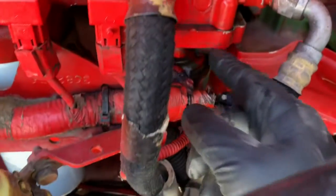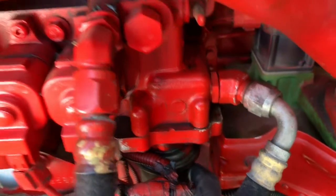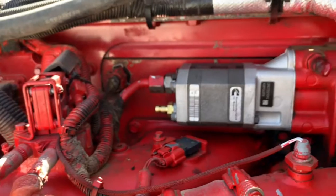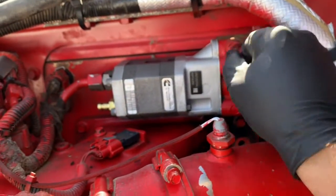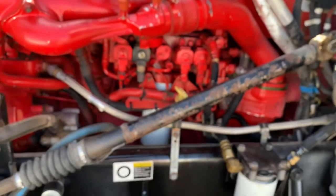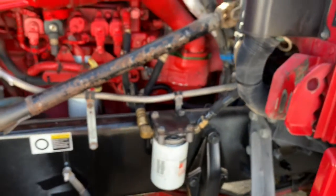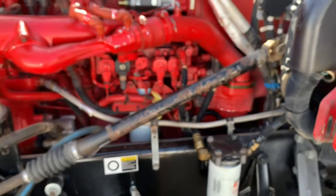If you can't start your truck and you don't hear any priming noise, that's this transfer pump right here. But if you hear the priming noise and still can't start, and you've got a fuel pressure code and no pressure at the test port, then you know it's this little gear pump. Always make sure you rule out any big fuel leaks — like I ruled out the cracked pickup tube — and that's gonna be it for this truck.